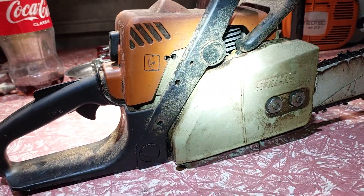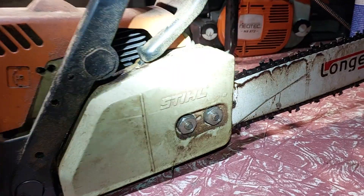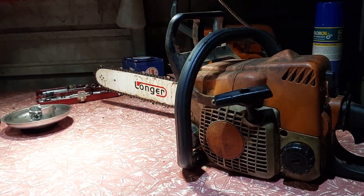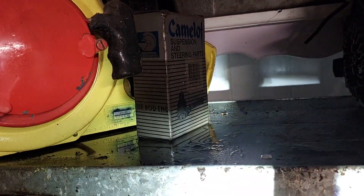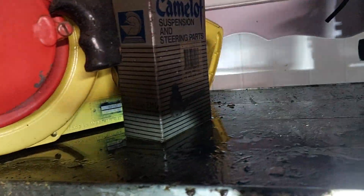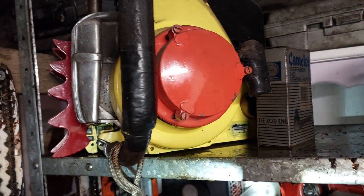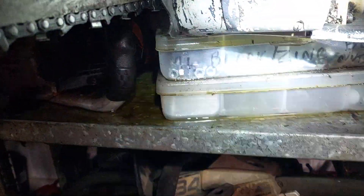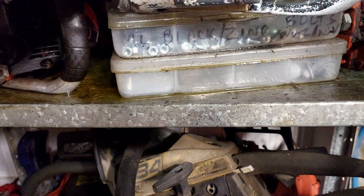I don't think the low compression is the whole story — I think it's actually the low mixture screw on the carby. So I'll get this going and do a proper tune on it. Maybe Dirty Ralph will actually un-dirty itself. But Dirty Ralph has a little secret — she leaks where she sat on the shelf. There's oil everywhere. I'll show you where she sits — she's dirty. There's a lot of oil leaked out from Dirty Ralph, all over the shelf next to my Stihl 635. That's why I call it Dirty Ralph.